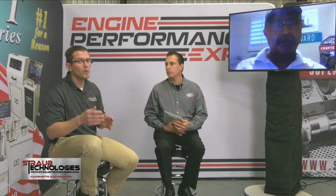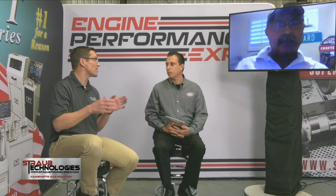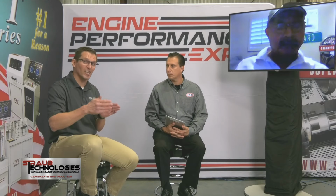But we have always done the acceleration test from a lower RPM to a higher RPM, and the computer itself does all the corrections for us. Other thing too is, in most cars, what you're trying to do is accelerate the car, which is why there are some dynos that allow the engine to freely accelerate, so you can actually measure the acceleration time. At the end of the day, that's what moves the car.